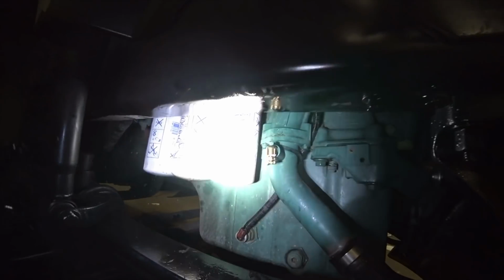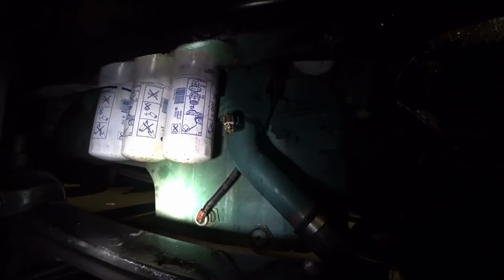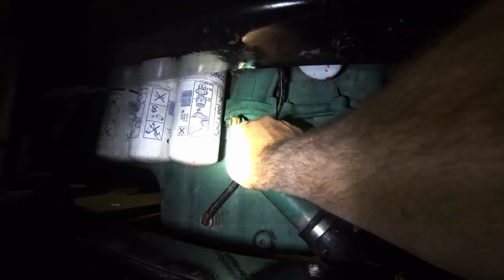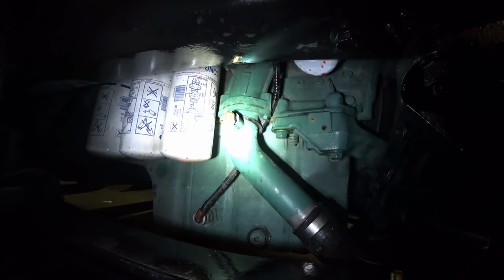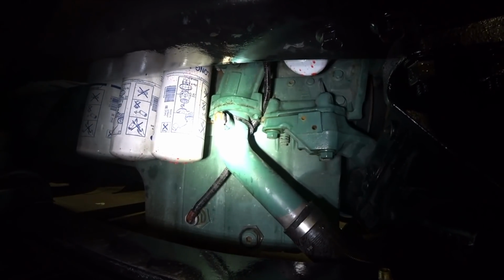All right, there you guys can see what I did. Put a drain cock in here for the antifreeze. It's actually off of an air compressor, and it's 1/4 inch. What you do is just put a wrench on here and pliers on here, and just open it. And the coolant will just drain straight down. Hoping it misses the leaf spring. It'd be close. But there you go.